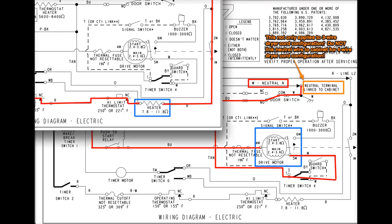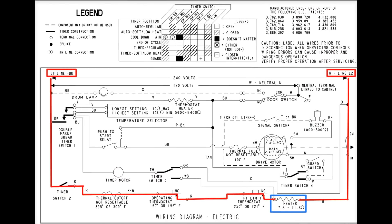Let's look at the heater circuit. L1 comes down through the timer, through some safeties and thermostats to one side. L2 comes down through the motor centrifugal start switch to the other side. We know L1 works, but we may have an open control in the heater. However, it's very unlikely to have two things broken at once. L2 may be bad — L2 can be bad and the motor still runs, but the heater won't work unless it gets both L1 and L2.